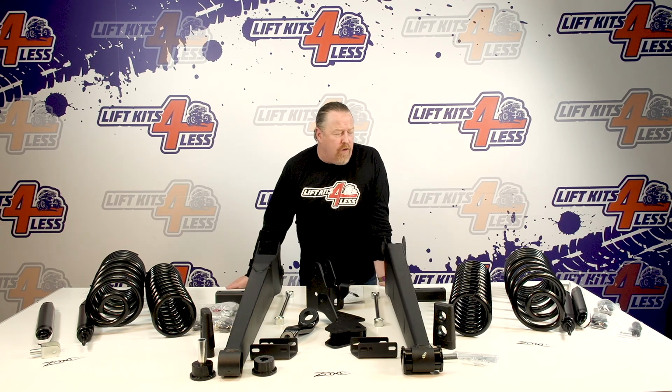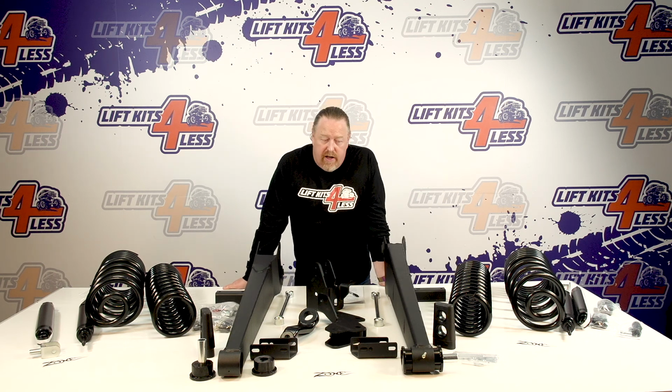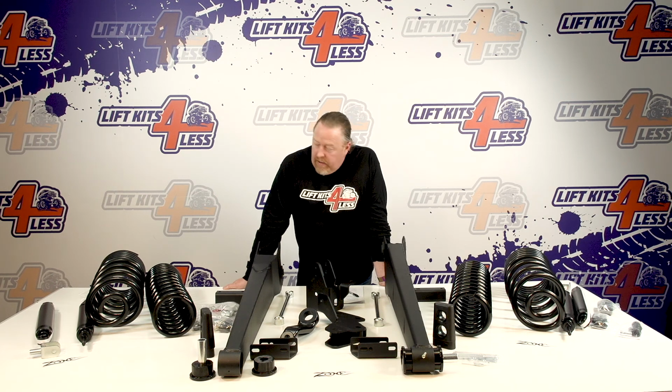They also offer a front transfer case indexing ring. So guys that are daily driver, you're not driving at a high rate of speed, the transfer case indexing ring really is not necessary. Now, if you are going high rate of speed in 4x4, you should add the transfer case indexing ring. If it's just a daily driver, typically never in 4x4, you don't need to spend the money. The other thing is you can always add this on later on, so that's another option.